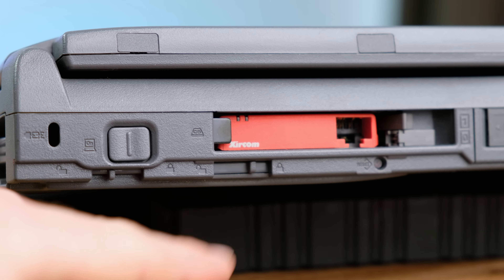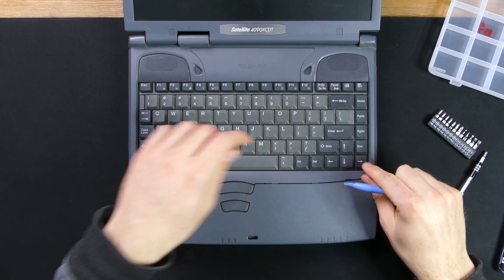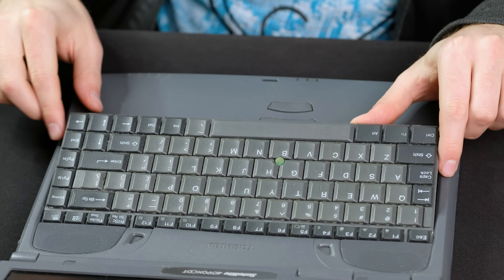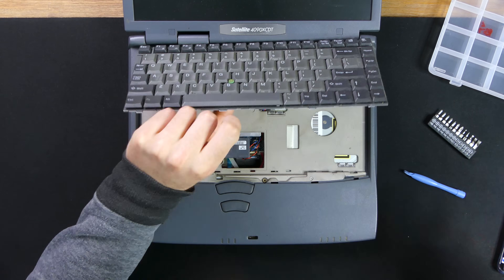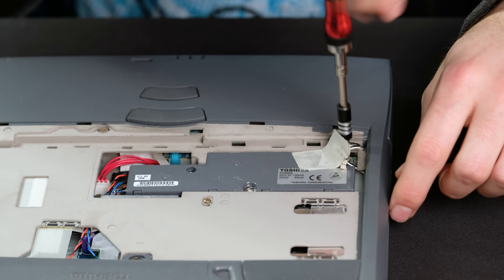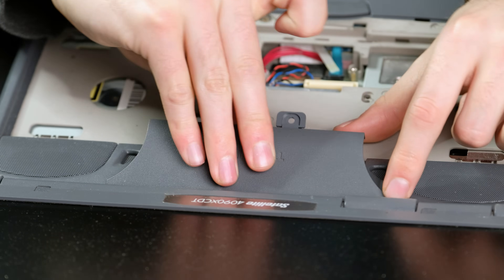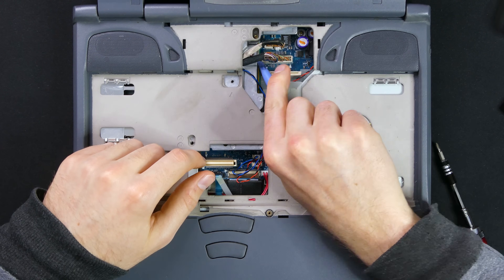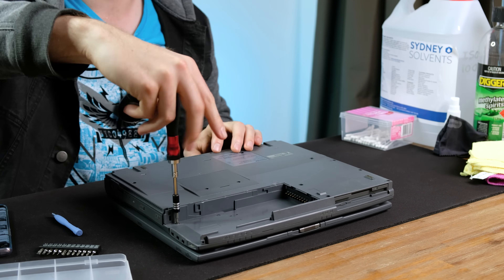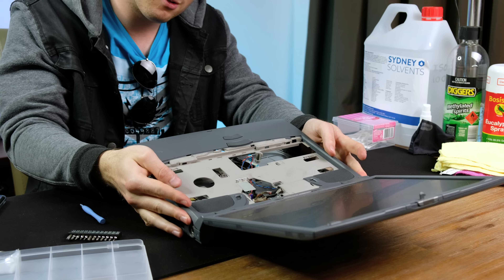There's also a small lock that stops the card from being yanked out accidentally. To remove the keyboard, I pried up on the plastic piece — there are about five plastic tabs that must be released before it'll come off. A single Phillips-head screw holds the keyboard in place, and it's attached to the motherboard with a long ribbon cable, which took a bit of fiddling to release. The 56K modem was next to come out, held by three Phillips-head screws. I was lucky enough to find a repair manual for this specific laptop online. I also detached the speakers and display cables connected to the motherboard, then removed the last screws holding the casing together — though the nut holding the hard disk screw broke off, making it a bit difficult to remove.